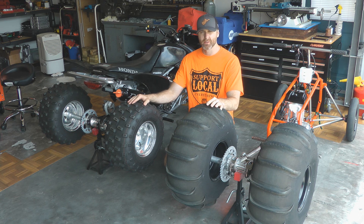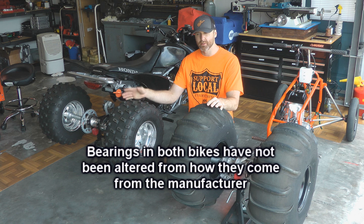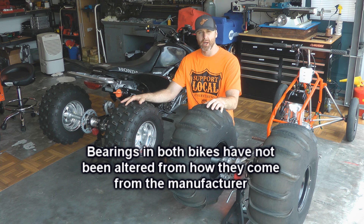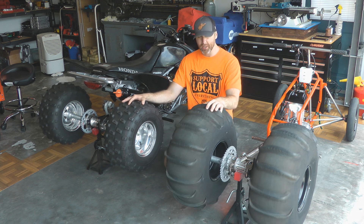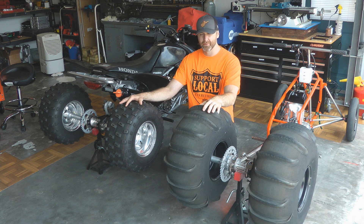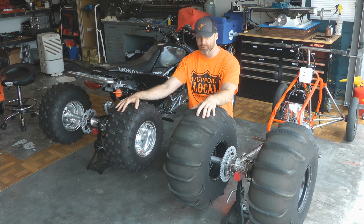We're going to do our spin test. On the right we've got the black bike with normal steel-on-steel bearings — steel inner and outer races with steel ball bearings, dual row. On the left we've got the orange bike with single row hybrid ceramic bearings — steel inner and outer races with ceramic ball bearings. I'm going to try to spin both at the same time with the same amount of force. I know that's not very scientific, and being right-handed will probably give the advantage to the black bike. Here we go.